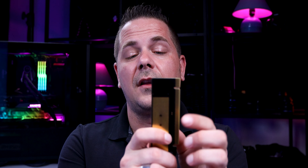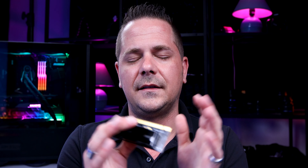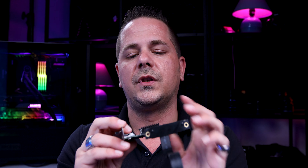No complaints. The issue happens when you look at your motherboard and you only have one X16 slot. Now you're thinking you need another drive for your workflow, so you get one of these NVMe adapter cards. These cards have an X16 slot — there are other ones with X4 as well. You put your NVMe drive in and it runs at top speed in that X16 slot. However, when you then try to plug this into your X1 slot using a connector that goes from X1 to X4, your assumption is that it should work — maybe at a reduced gigabit speed instead of 10 gigabit — and I was okay with that.